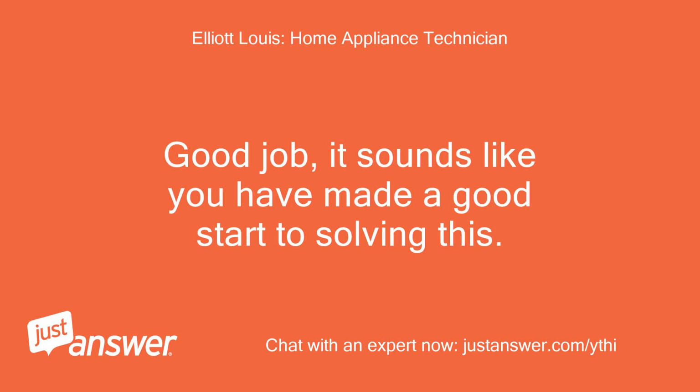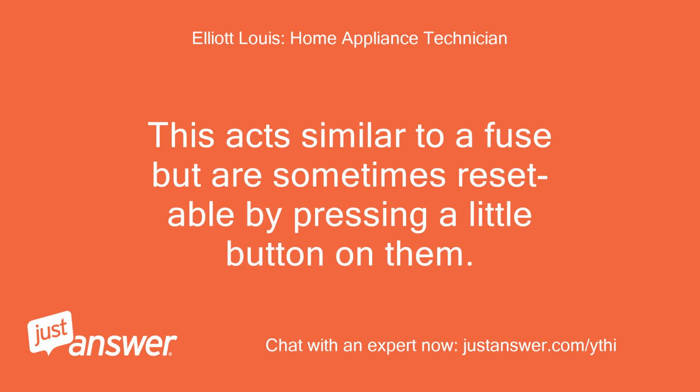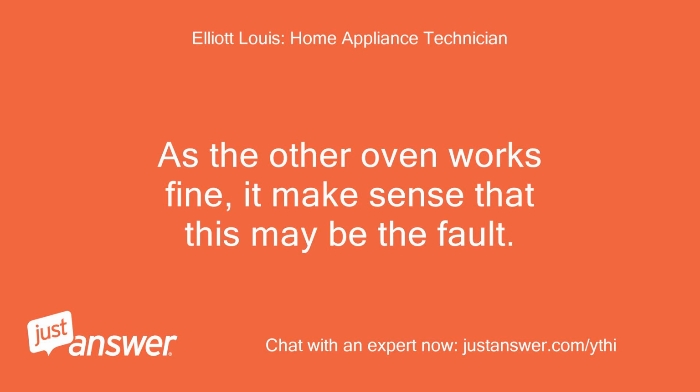Good job, it sounds like you have made a good start to solving this. Another thing you can look for is what is called a thermal overload, TL. This acts similar to a fuse but is sometimes reset-able by pressing a little button on it. There is one for the main oven and one for the smaller oven. As the other oven works fine, it makes sense that this may be the fault.